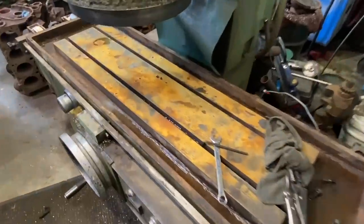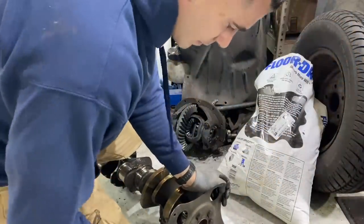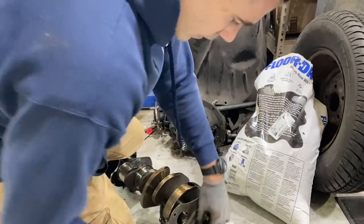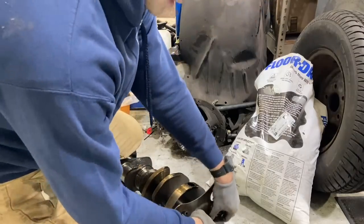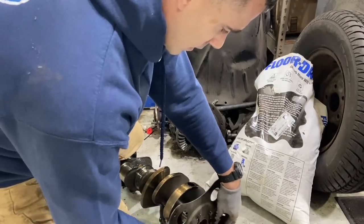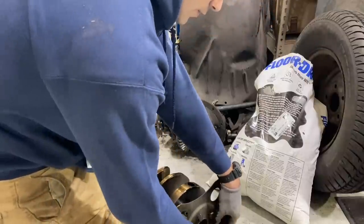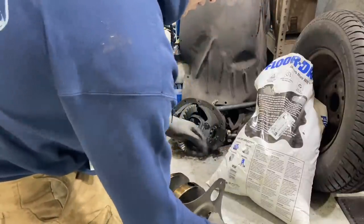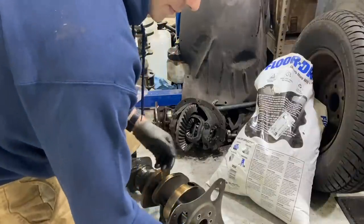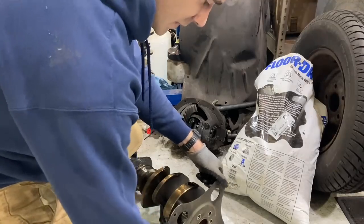Yeah, do a little better than that. Splitting off these bolts here holding on the flywheel, and you can go ahead and get this crank along with the caps and anything else you want to keep over in the hot tank, and give it a nice chemical wash. And then we can store and wrap this crankshaft for safekeeping until we need it. And this thing could very easily be cleaned up and may need a little machining just to clean up the journal surfaces, a little polishing, and she'll be good to go.